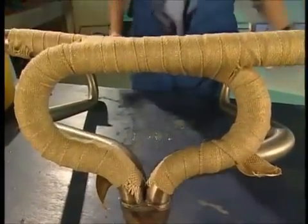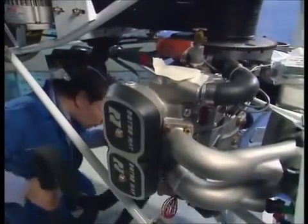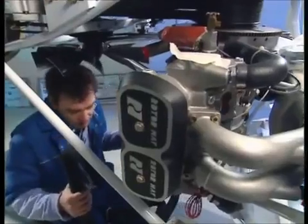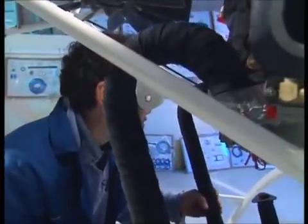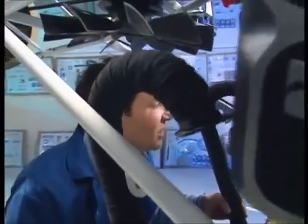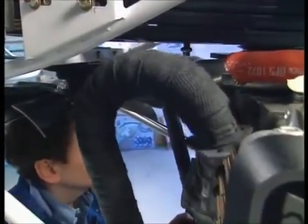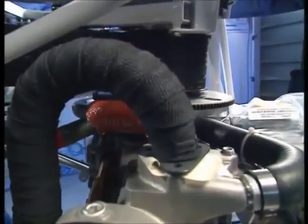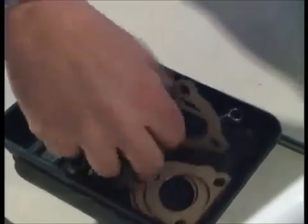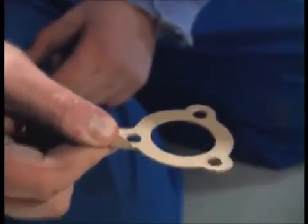Lovely jubbly — there you go, all wrapped and painted with heat-resistant paint. Doesn't it look gorgeous? All I've got to do now is fit it. I've put some tape over the exhaust ports to stop any debris dropping in, but obviously I'll take that out before I actually fit it. Now, this is a bit of a tight squeeze to get up here because the airframe tapers back where it's got the tail boom support. That goes up there like so, and then it should sit up onto there like that. With that roughly in the right place, I can then think about gaskets — just three-cornered, and quite cleverly there's a little handle on this side so you can just joggle it about a bit when you need to.